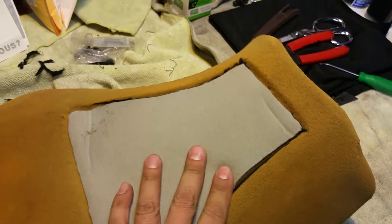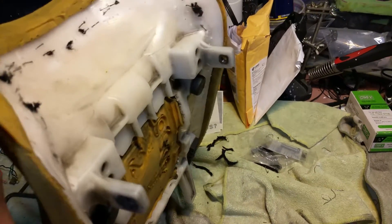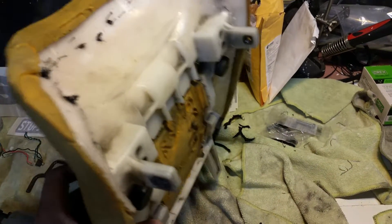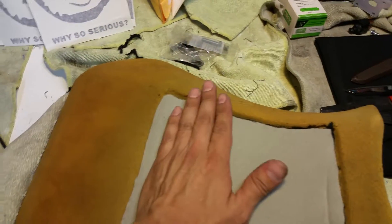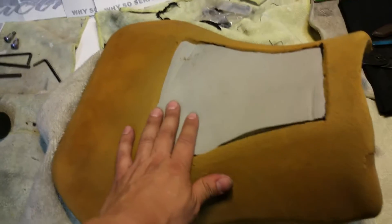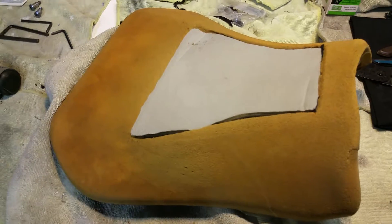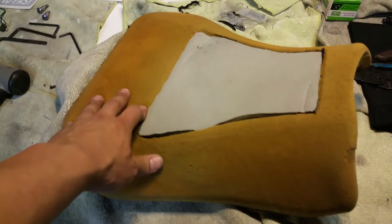To help eliminate that and keep my ass planted, I went ahead and cut it down about an eighth of an inch. I've separated it here so you can see it — it's not nothing special but there is some depth in there. Along with the cutaway on the bottom, it gives when your ass comes planting down. Normally you'd come down and hit the plastic, but this way you get a little more flex. Your body weight makes you sink down into the seat and it gives you this lip so when you slide back as you're giving gas, you get caught on this indentation.